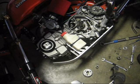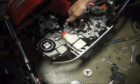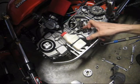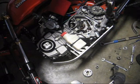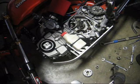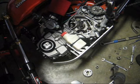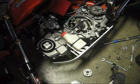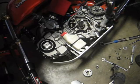Alright, at this time it's probably best to check your timing chain. Just make sure that it doesn't have a bunch of slack, and check the teeth on your oil pump. For some reason they seem to wear sometimes, at least in my experience. So just make sure that that's all good in there. And then you're ready to install your new inner rotor kit.